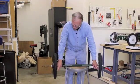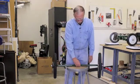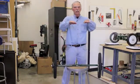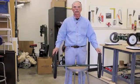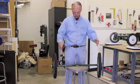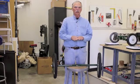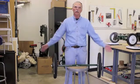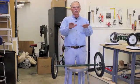If we move the forward parts of the wheels toward the center line, this condition is called toe — just like your toes. Think of skiers on the bunny slopes: they're taught to point the tips of their skis inward, which is more stable, called the plow. Same thing on a vehicle: if you want stability, you turn the wheels' leading edges in toward the center line — that's called toe in. The backs conversely move out, giving you a more stable vehicle.